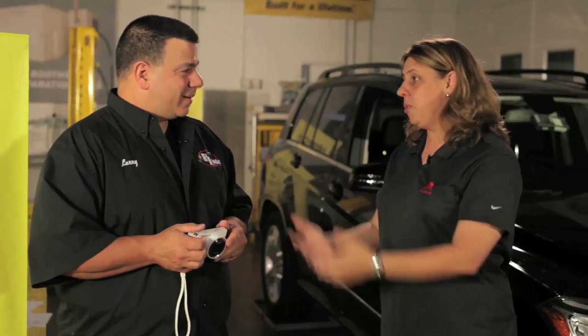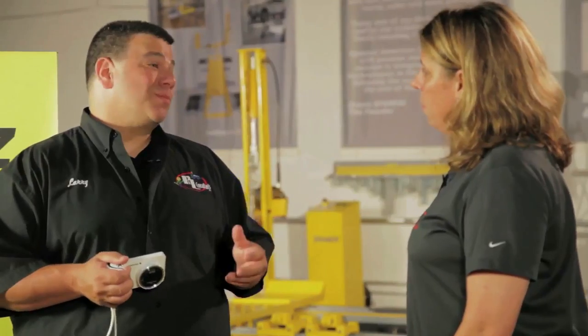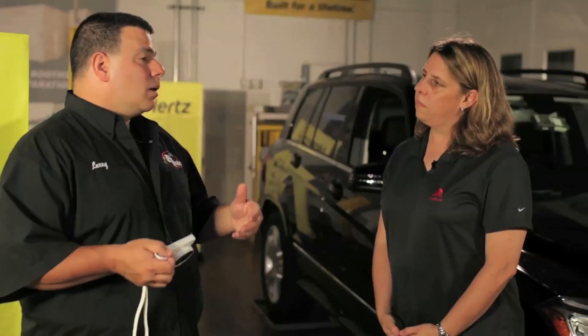One thing often missed in shop photography is proof of replacement compared to the damaged part. You should have pictures of both the new part installed and the old damaged part side by side. If someone photographed the damaged suspension part before repair, you now have an undamaged part in there as proof. It's all about documentation — proving that you did something to this car. Just like when it's on the frame machine, you want measurements before, during, and after. Always have proof of documentation.